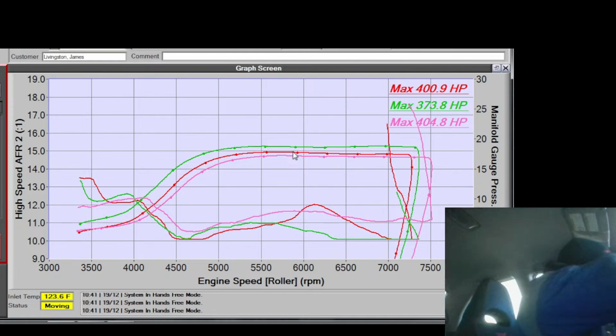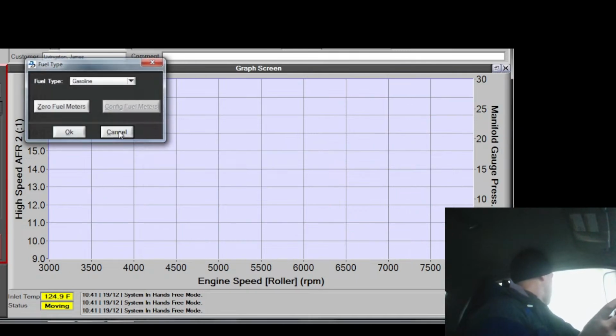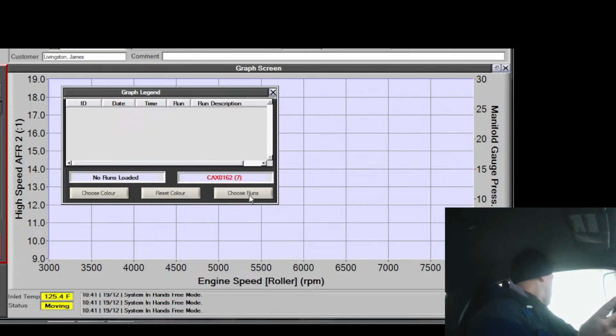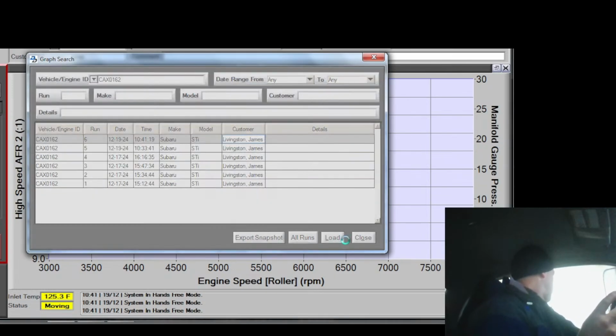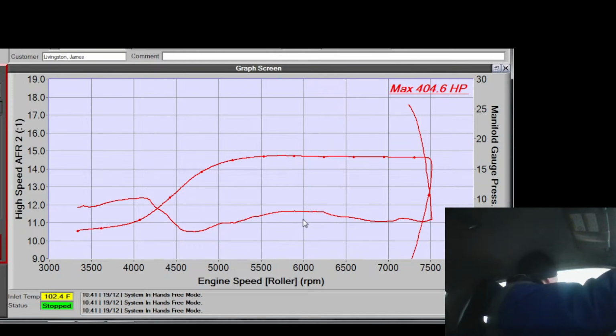That looks way better. A little lean, like I said. Figured it to be a little lean. But that's way smoother. Whoopsie, that's the wrong button. It is way smoother. Let's look at that. There we go. And no ridge misfires. So I've got to fatten this section up a smidge, which I figured I might have pulled too much fuel out. This came down too. This is the low edge right here. I'm fine with that. That's 12s at 3 pounds of boost. I actually like that. That's what I want. This dip is a little big still, but still 10.5, I'm okay with that. That's not terrible. 11.5, that's terrible on pump gas. It's a good thing I'm not even timing this thing yet. So I've got to fix that.